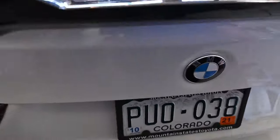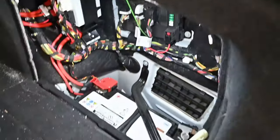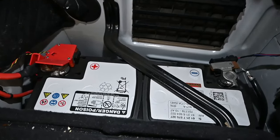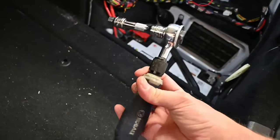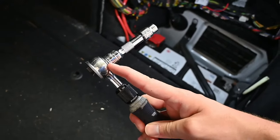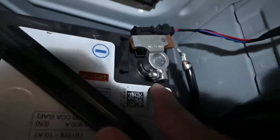Whenever you're working on something electrical, it's always a good idea to disconnect the battery so you don't cause electrical damage or hurt yourself or the car. The battery is hiding here behind this panel — you just go ahead and pull that out. Down here is your battery. All you'll do is disconnect the negative, which is the minus. We have a 10mm socket on an extension and we're going to go ahead and undo this little nut.